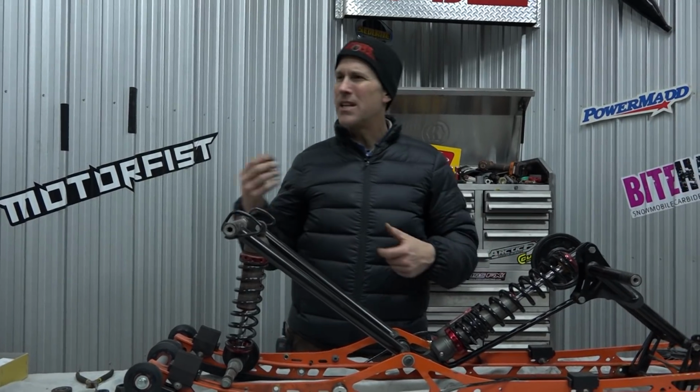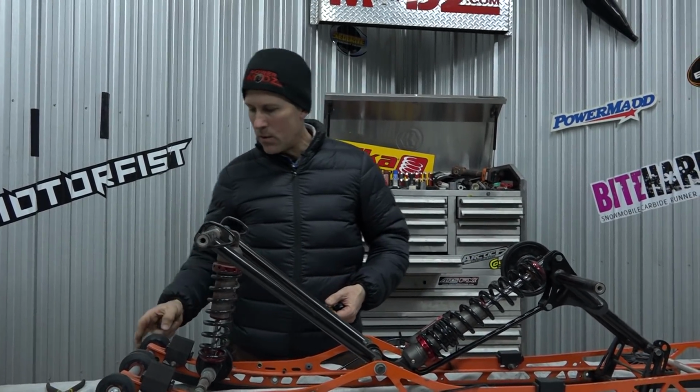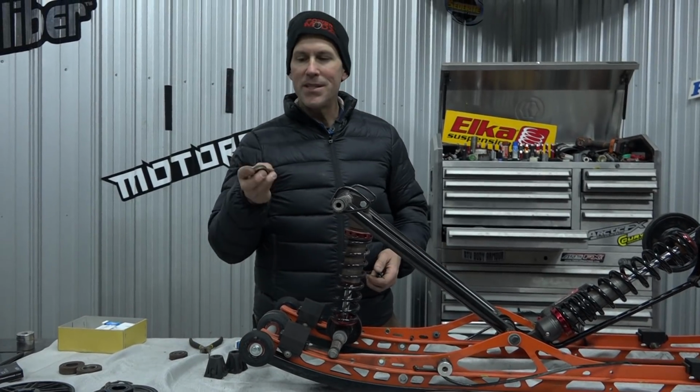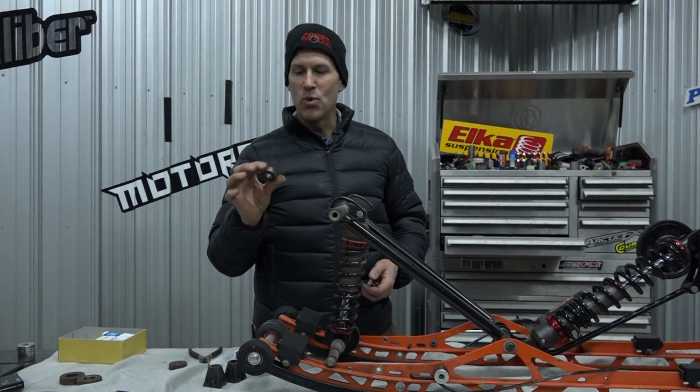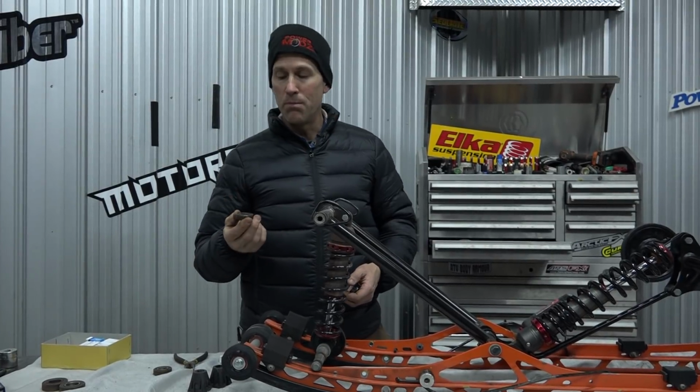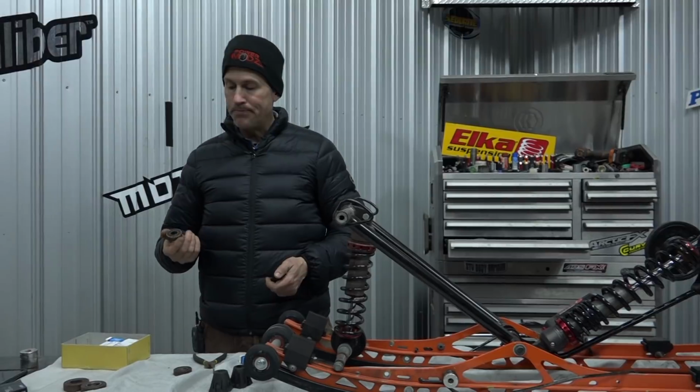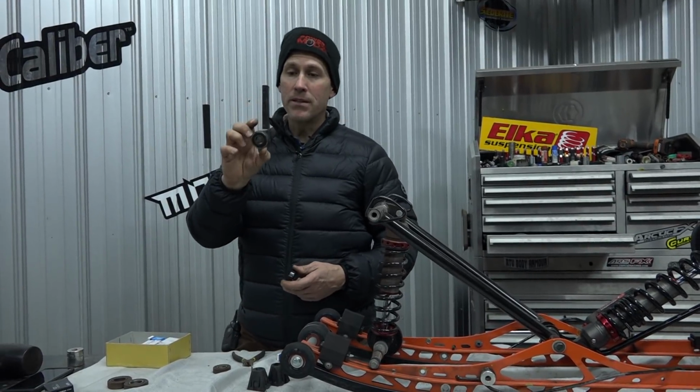And we run into this problem a lot with our sleds when they feel like they're really dragging. Your sled's working hard. Like, what's wrong with my sled? Have I gone through my clutching? Is it down in compression? What's going on? You know what? Just a few of these little idler wheels in here, when these bearings seize up, they'll really work your sled hard. They'll wear out your clutch belts. They'll make it feel like it's really dragging butt. And that's just those little bearings, right?